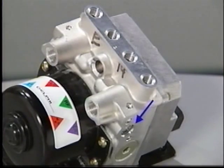This difference in pressure at the BPMV makes the pump motor and solenoids work harder, causing noise. It's the hydraulic fluid — because you've got pressure waves that run right through that fluid. There are damping chambers within the modulator that quiet the noise. What the system is doing is giving you the maximum traction available, the shortest stopping distance, and stability so that you can steer the vehicle around any obstacle. The trade-off is that we are using a pump and solenoid system, and the solenoids do make noise. You get the extra maneuverability and the reduction in stopping distance.